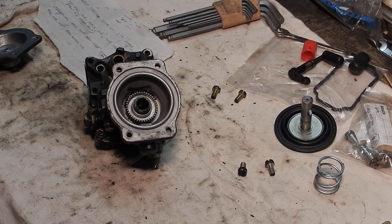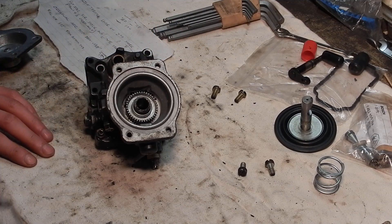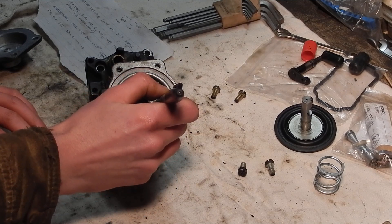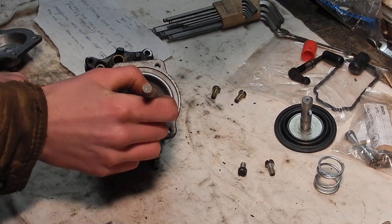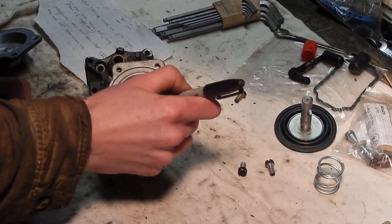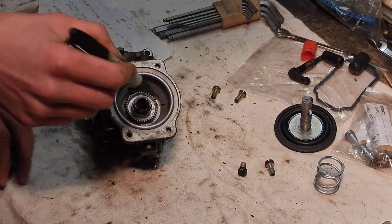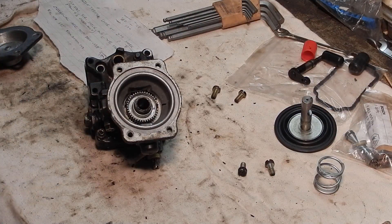It's always important to make note of where you started. This is a stock pump — no one's ever messed with it, the paint was intact, the safety caps were intact — so I know this is a clean slate. I'm going to take a Sharpie and make a mark on the housing and on the star wheel itself, as many places as I can in case the mark gets worn off through usage. So that's our zero point.